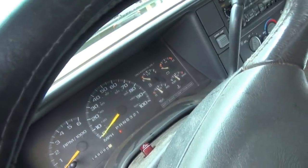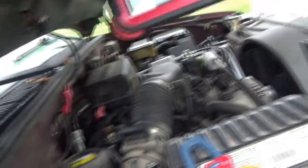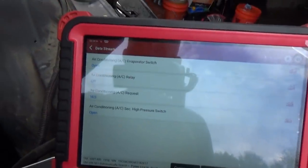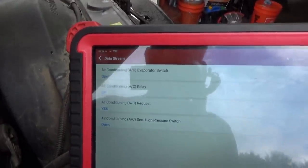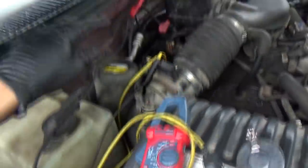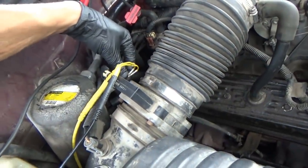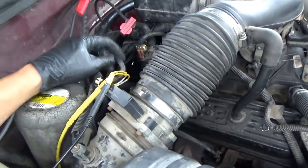That explains the intermittent nature of it. On our scan data, we can see — if I wiggle that switch, there it is. It's open, it should be closed when I push it in. So is it just bad contacts, or is the switch internally messed up? Ohmmeter connected just to the switch using the AES wave adapter kit — nice tight fit. I want to flex the pins and see if the sensor itself is internally messed up, or if it's just these pins on the connector — like terminal fretting.